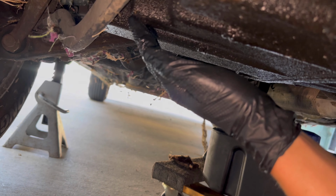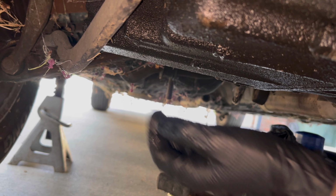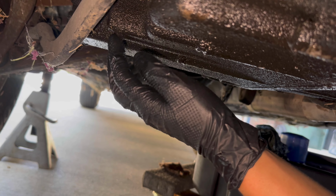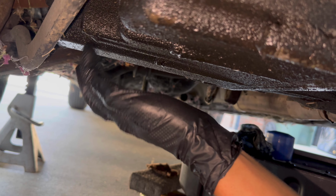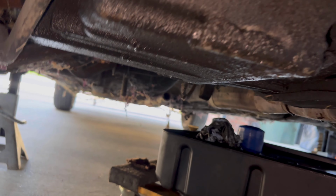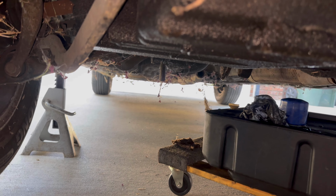Then we'll jump over here, get the drain bolt off the trans, try to clean it a little, but it's probably just residue because every time, at least every Honda I've seen, people don't really change the drain plug crush gasket, and that's what happens.